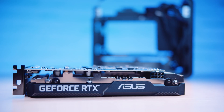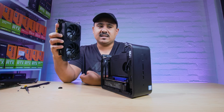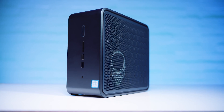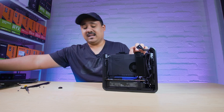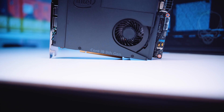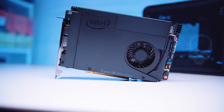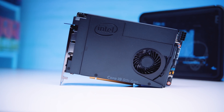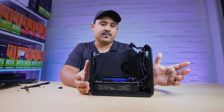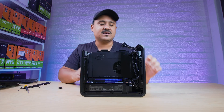Word on the street is there are other vendors making cards for these types of chassis. Now this platform isn't just about being made by Intel — there are other companies like CyberPower who are using these new devices. Now this looks like a regular PCIe card, but don't let the looks fool you, because it is not a PCIe card. They call this a compute element — basically it's a device the size of a PCIe card, but it's got the CPU on it. You can't just pull this card out and plug it into your computer hoping to double performance. It's literally a compute card.